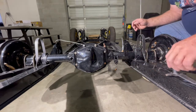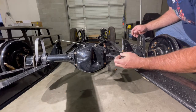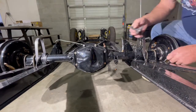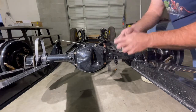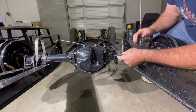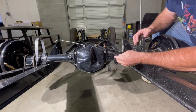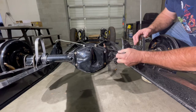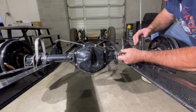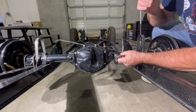First things first, we have to put in the emergency brake cable stuff, which comes from here and runs — there's a cable that runs from this turnbuckle to here, and then one to the opposite brake. We put that in first. I've got to figure out the routing since I didn't see this thing come apart. So we know where to run our hard lines and avoid all the emergency brake cable junk.